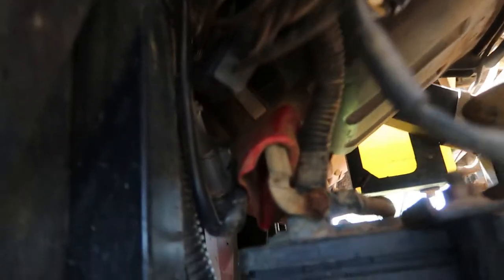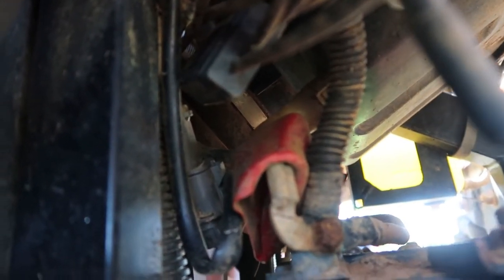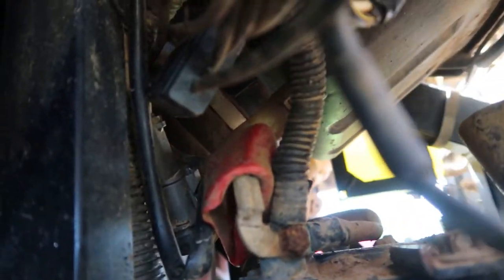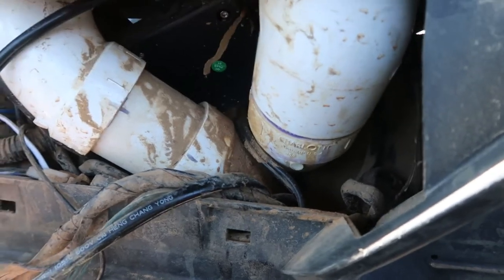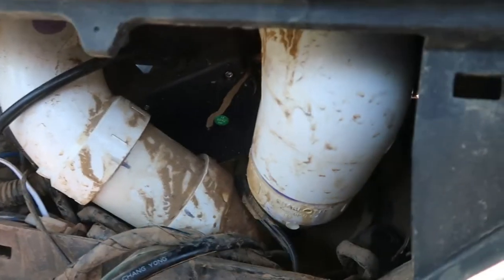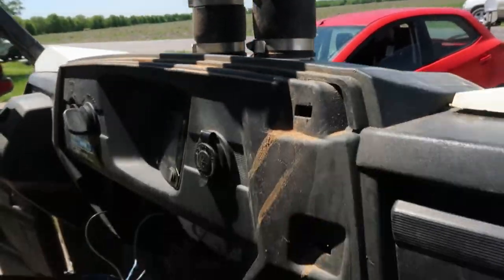That would be your belt intake. Now your motor intake — which is going to be incredibly difficult because it is very tight. You can just barely see the clamp. I use the factory rubber spot off of the motor intake, use that and go to PVC again with the glue. It's a very short piece that comes out of there — just basically a couple of 90s. Again, I have the list in the description where you can see that. So that would be your motor intake — tight fit.